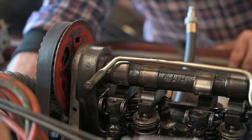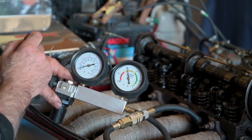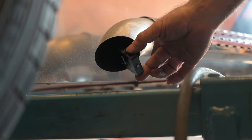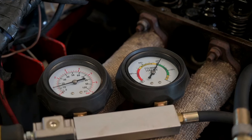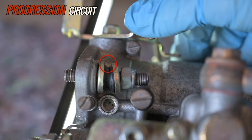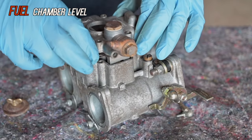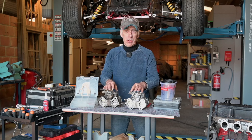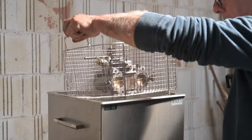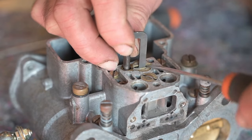Now I could start to bleed the brakes and pay more attention to the engine. We had a pretty low pressure earlier, so I did a blow-by test on the engine to see where it was leaking, but it turned out there was no real issue. Then it was time to start rebuilding the Weber DCOE 40. I took the complete Weber apart, changed all the jets, realigned and readjusted it, and put the carburetor into an ultrasonic bath to clean it, then gently removed all the parts.